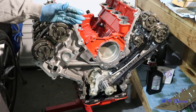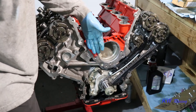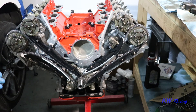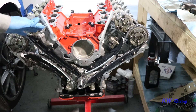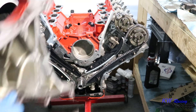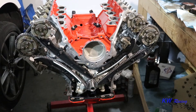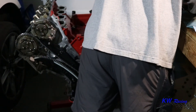Now we're ready for the right side of the motor, which is the passenger side. We're going to throw the timing guides on the motor along with the chains as well. We got the timing all done finally — we have come to an end of the timing on the Coyote motor. We're going to do one last thing to finish it off and install the timing cover. I was just putting the gaskets on there along with some RTV to make sure I have a good seal.